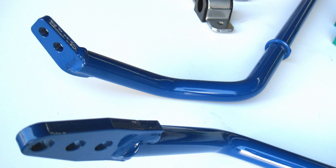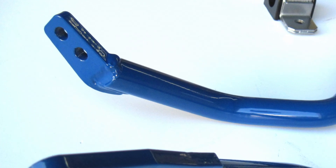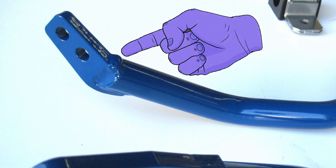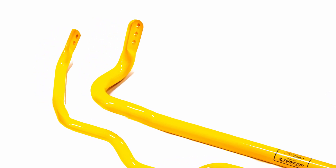Now a couple of other things about how aftermarket anti-roll bars are made. One is the end part of the bar where it's attached to the tube or solid bar itself. It can be welded, as in this example — and these are really to be avoided, because welds can cause hot spots and stress points which could later lead to cracking and the bar failing. So if you're choosing an anti-roll bar, look for just one piece of metal formed out of one solid tube or bar. You can see on these ones the ends are basically crimped over as this hollow bar, so there are no welds — nothing there to fail. It's as strong as it can be.